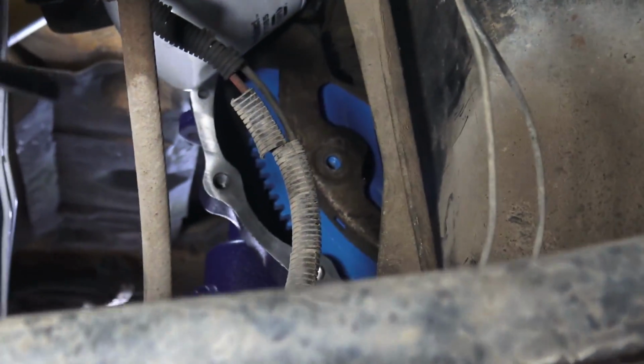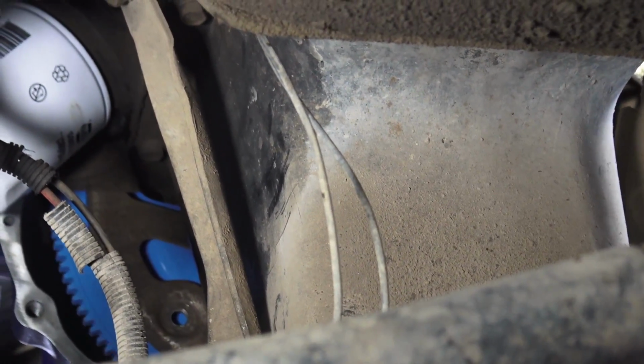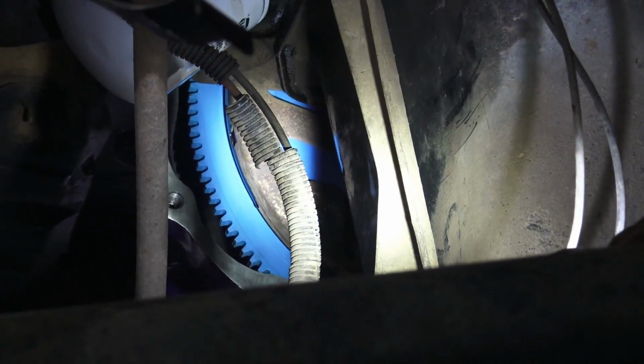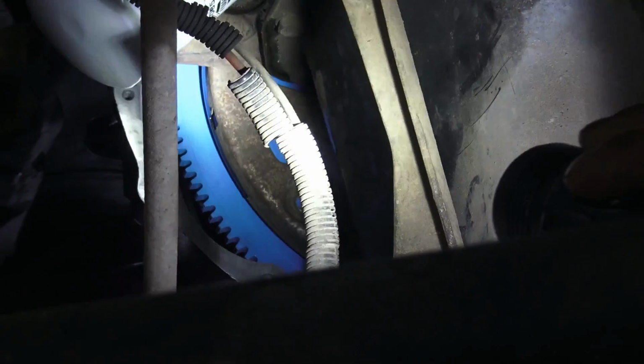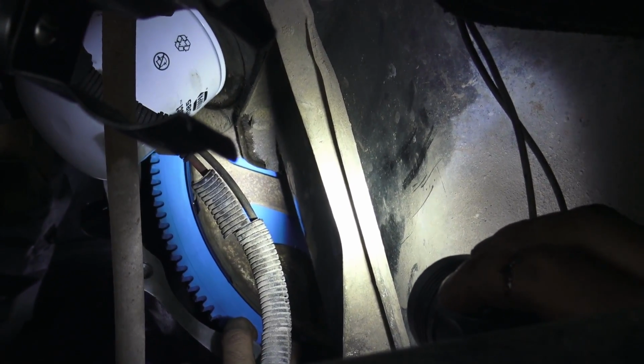If I can see that. Oh, yeah, I can see the torque converter. See the flex plate and all that stuff. Cool. Guess the offset's not going to work. Not worry about that on this one, huh? Does the torque converter already come with oil in it, doesn't it? No, it has to pump up from the pan and go. It seemed awfully heavy for a chunk of metal. So that one's got the dot. We'll try to see if we can align this guy.